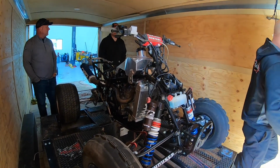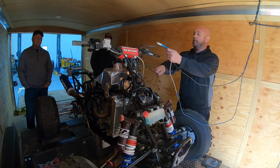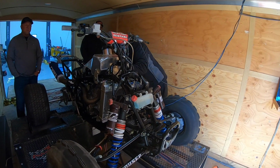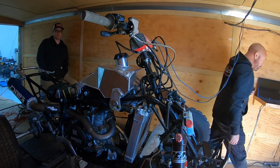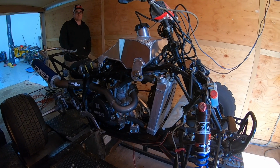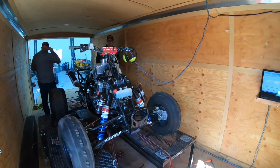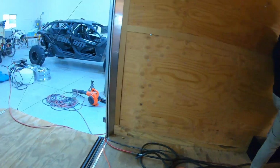And didn't he have to get different maps? We're gonna see what we can do, switch around. And yeah, because he doesn't have his plug. We changed the map yesterday, the MR12 map, and it added fuel, so it wasn't near as lean. But I don't think there's really a downside to it other than that it pulls some timing. Theoretically. Maybe he just richened it up. I don't know. So we'll see. But it starts up, sounds good. Get it all together. See if the clutch cover doesn't leak. Check that last bolt just for safety.